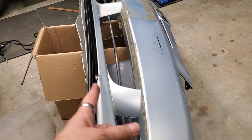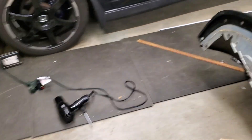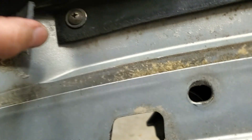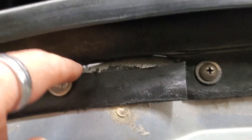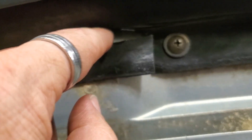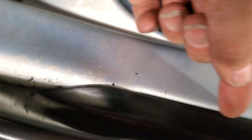I was proud of that, and I didn't use a heat gun — I just used a regular old hair dryer so that I wouldn't overcook it. You can see how it had that hump based on the way it kicks out. So I just clearanced everything with the Dremel and then cleaned that line up as best I could so that it would look like just a little lip that goes along.